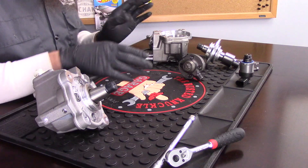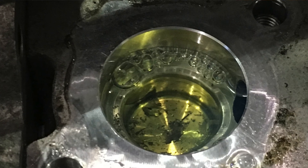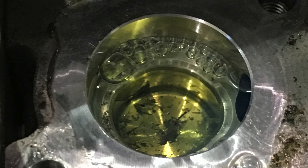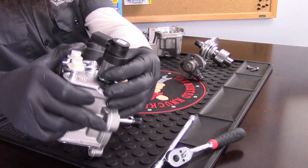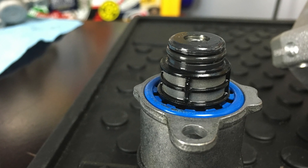So how do they fail? I've actually seen them fail in two different ways: the catastrophic way and the not-catastrophic way. The catastrophic way is where something inside of the guts of this pump comes apart and actually blows metal through the entire fuel system. I say catastrophic because if this happens, we're replacing basically everything that fuel touches inside of the vehicle. I've also seen them fail not so catastrophically, where perhaps this valve that's bolted to the top fails. The great thing about that is it's just a simple pump replacement, because from Volkswagen this valve is not available separately. That metal that gets blown through the entire fuel system can come from a vehicle being mis-fueled — putting a full tank of gasoline in it and running it till the car doesn't run anymore generally does damage to the high-pressure fuel pump.